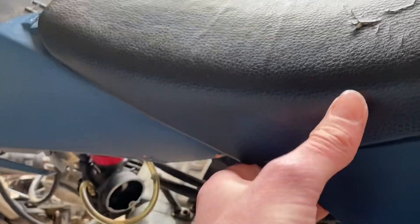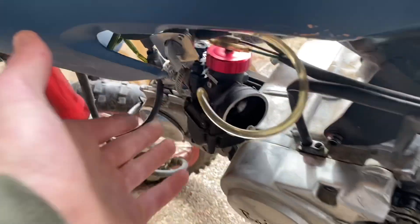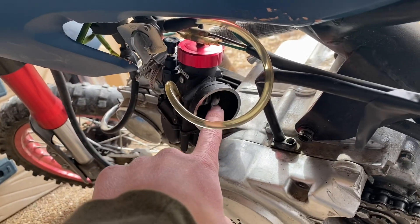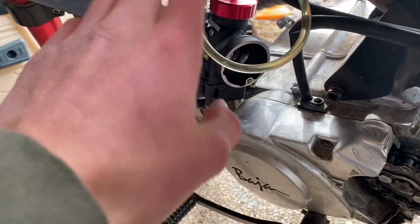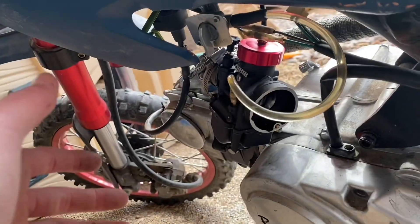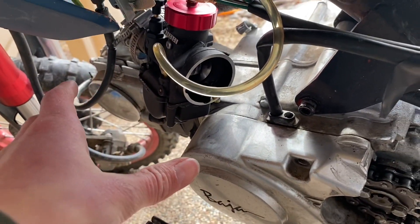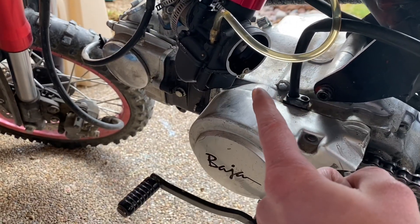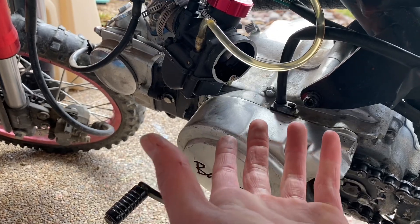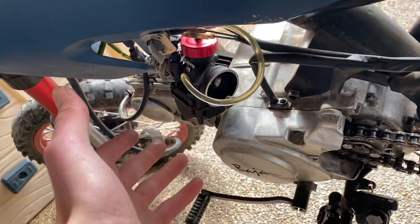Check if it's got an air filter. On some bikes you need to get under the seat — bring tools with you. If there's no air filter, like on this one, and he's been running it without an air filter, that means the motor and carburetor have been sucking in dirt and gunk. You might even need a new carburetor or need to do a thorough cleaning of the entire engine, which would not be fun. If you find it, see if the guy will go down on the price a couple hundred bucks, or just don't get it.